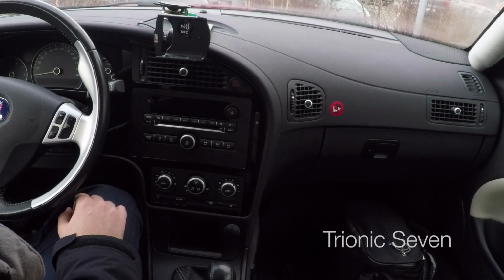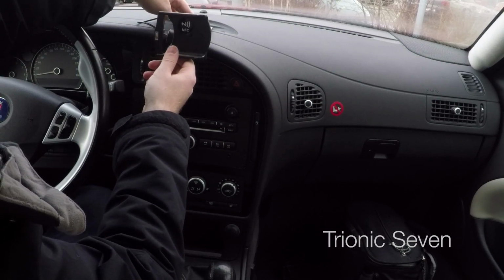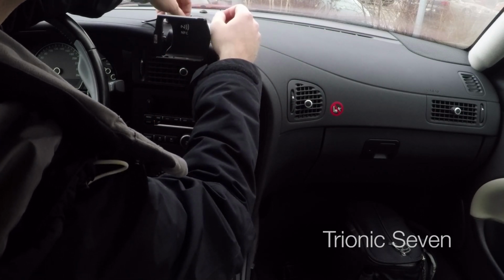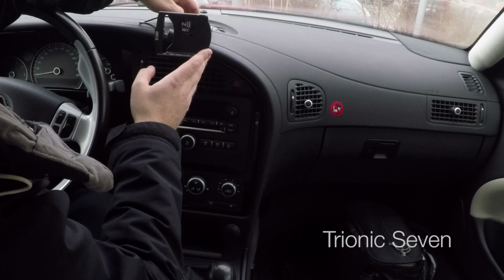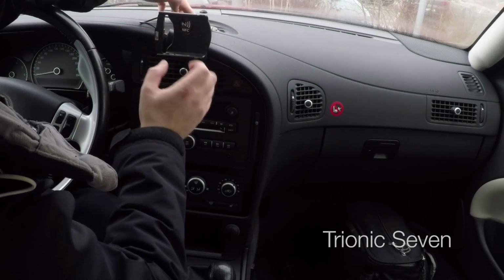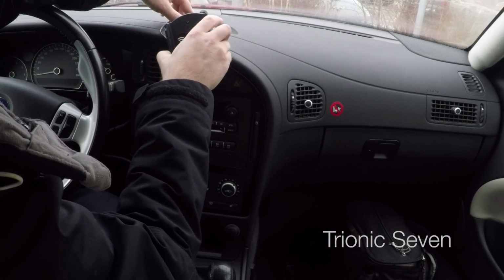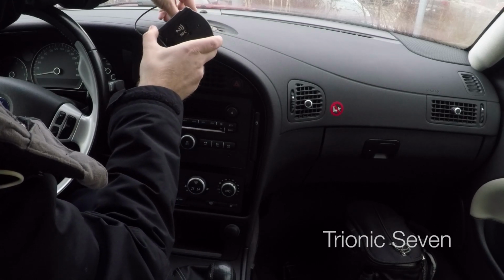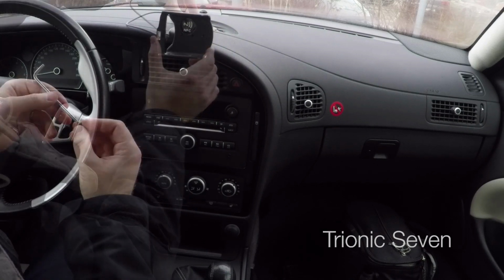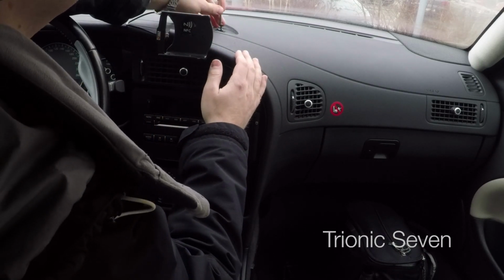The only remaining thing is to put the speaker back on, which will hold the back end of the holder down. Make sure that the speaker is actually holding the phone holder down. Then try to measure the approximate length of cable you need for the swivel to turn freely. And then use your T25 Torx wrench to put all the screws back together.